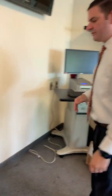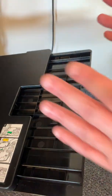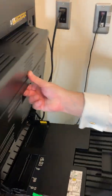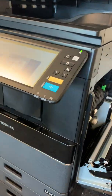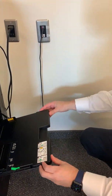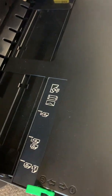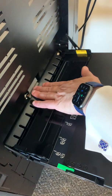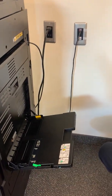If we come over to the right side of the system, the device is equipped with a 100-sheet multi-purpose bypass tray. There's an extension here which will allow you to reproduce 11 by 17 and 12 by 18 paper. This is also the section where you may have an occasional misfeed, because paper travels up the right side of the system and then straight out to the output area, so it's very simple to get inside the machine. The bypass tray has icon indicators letting you know that you can put your stocks, envelopes, and sheets of labels in here. You put your media on the tray, it tells you the orientation, lift the latch, then close it so the roller catches it, and the device will feed the media through. The bypass tray is also a standard third paper source on this series.